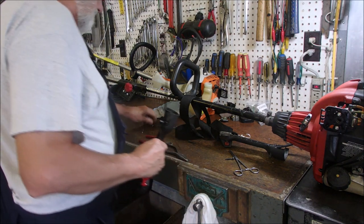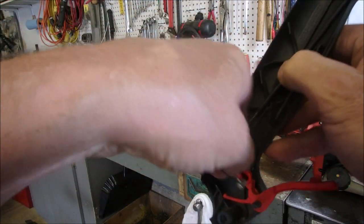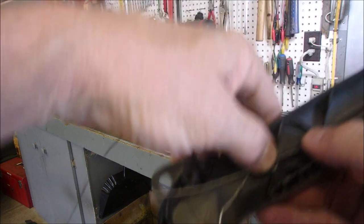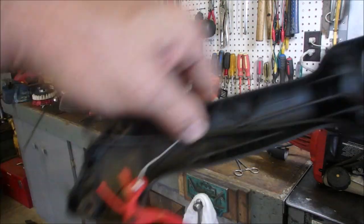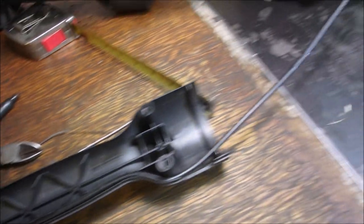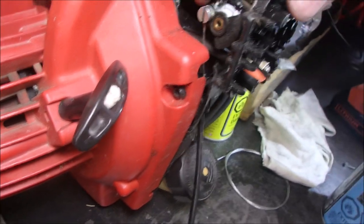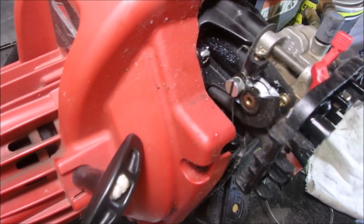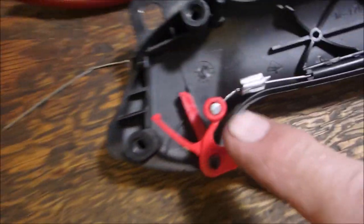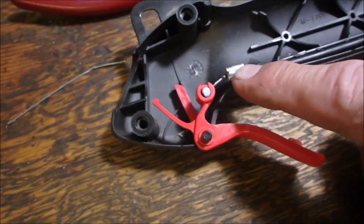It's too big. On the cable that matches up with this fella, I'm going to stick it in there like that and splice them there. I don't have a lot of room so I've got to get it just right. It looks a little clunky looking, but I've got the new end in the throttle connector. And I've got the old end that came with the original cable — it was rotten. I only had about 4 inches that was any good. And I swaged them both together.